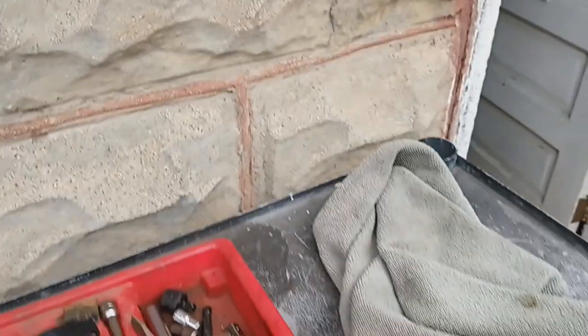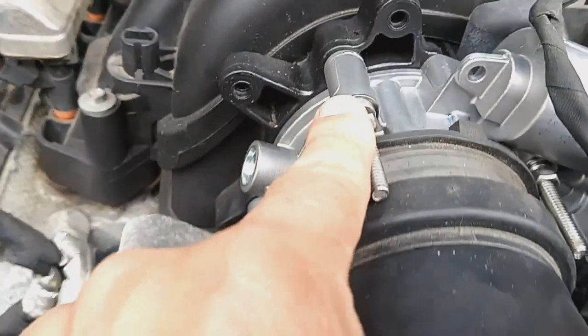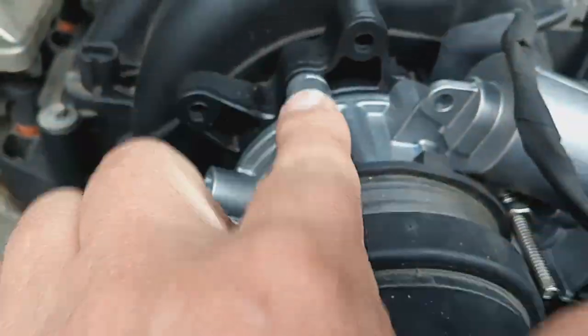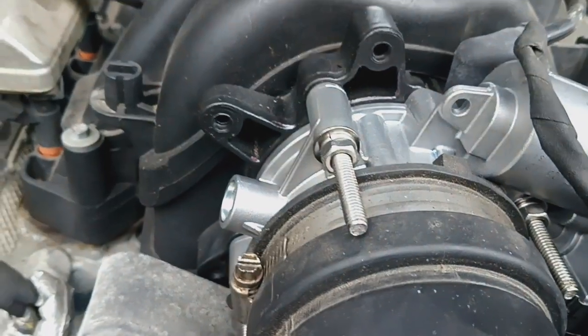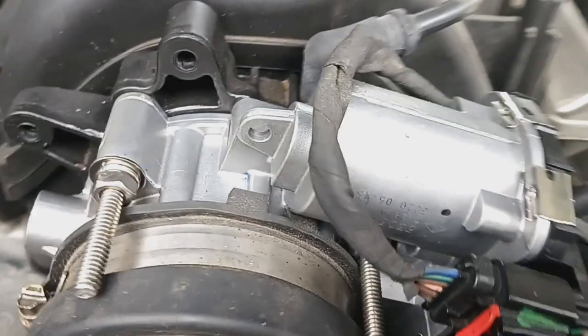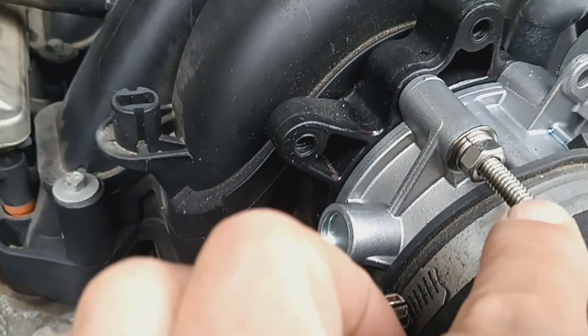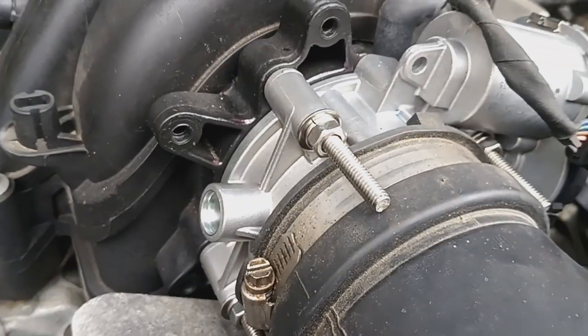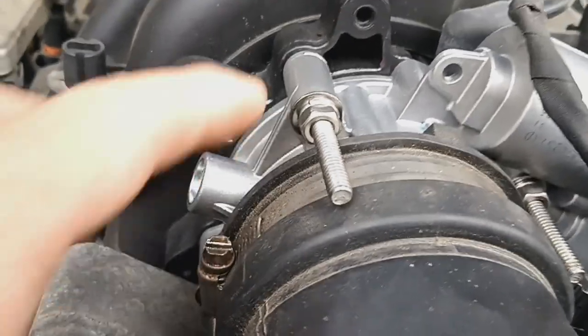While I'm at it, let me show you another thing I did. I just got this Charger so I'm starting to fix it up. The bolts that go in here have green heads — they're green-looking with a real thick coarse thread — and they strip out on you. The way I fixed it: these are just three-inch quarter-inch posts you can get at Ace or hardware stores. Find yourself a lock washer and a nut, and just take a little quarter-inch tap to clean it up.